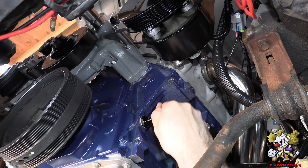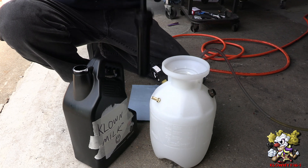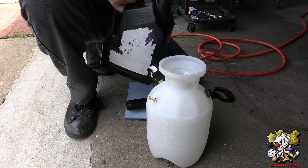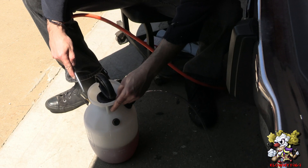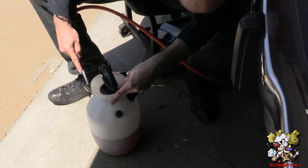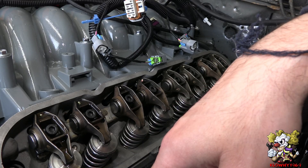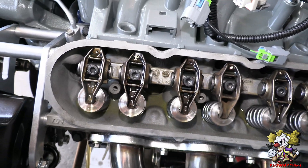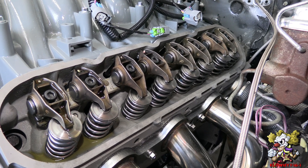Press the hose on. Now take this off and we're going to use some clown milk — AKA engine oil — to oil up this engine. And tighten her down. Alright, now it's go time. We're putting in about 20 PSI. Look at her go in the engine! And as you can see, we're getting oil coming out of here. So we periodically cranked over the engine — it took about 15-20 minutes — and all the rocker arms now have oil. And that's how you make a pressurized oil primer by yourself. Thanks for watching.